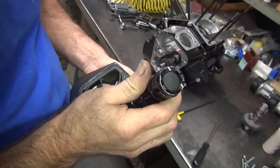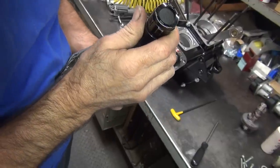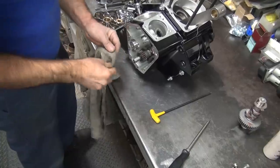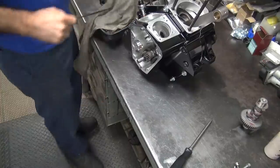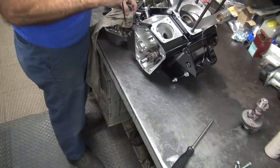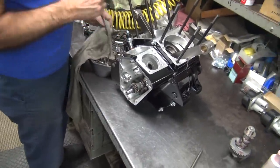I saw where it was hitting. I can cheat with the reamer a little bit and cut that little area away, but I don't see a single mark in there that I can identify. So put a lapping compound down there and lap it in, but the problem with lapping compound is it embeds in the bushing and never quits lapping. Mm-hmm. The gift that keeps on giving.